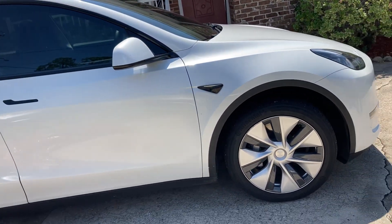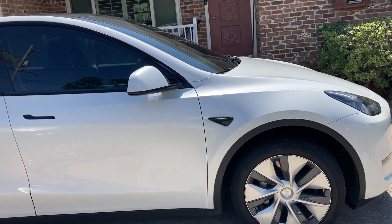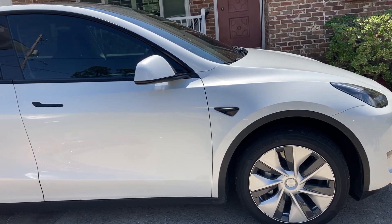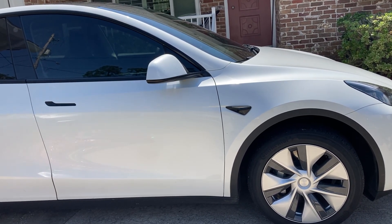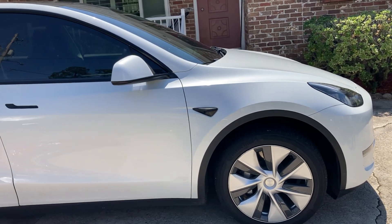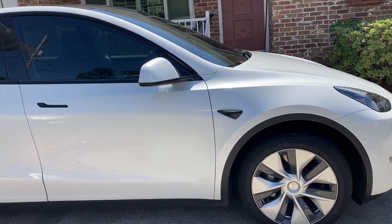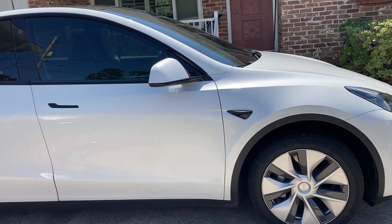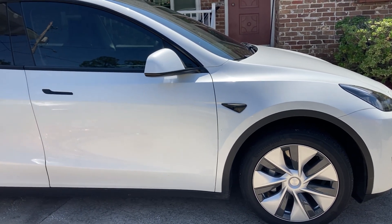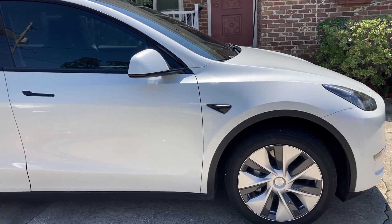Your fronts are almost there — they're just steer tires. So I wouldn't move the front, just leave them where they are and put new ones in the back. I'll probably skip the first rotation because the new rears need to catch up to the fronts. Around 15,000 miles on the rear tires, then I would probably do the rotation. You should be good for a while.